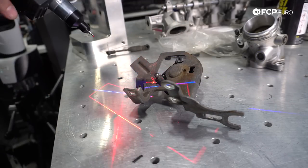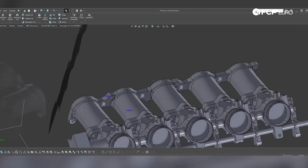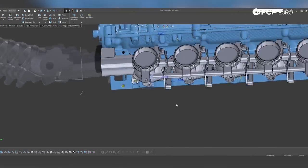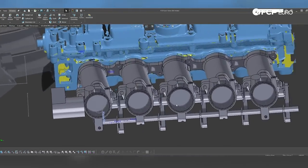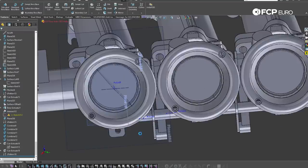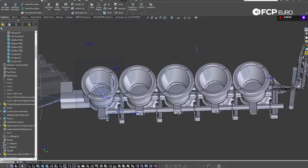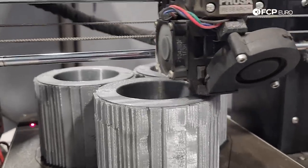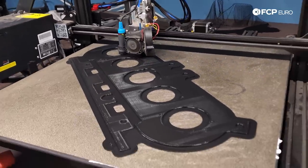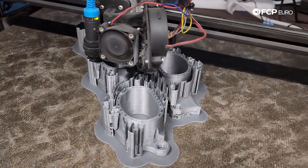There were two main design approaches that I worked on and eventually one prevailed. The first was to mount the throttles, fuel rails, and linkages upside down with tons of hood clearance, facing the stacks downwards. This gave us the most room for the giant BMW OEM throttle position sensor on the driver's side and injector serviceability on top. However, after days of staring at both options I realized that the beauty of the brass throttle blades just had to be on display — so the challenge of cramming the throttle position sensor, fuel supply, and airbox began. With all parts being printed out of PETG instead of PLA, it gave us a little more flex and wiggle room going into the car, in case anything didn't fit perfectly.